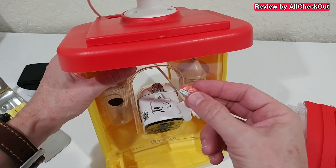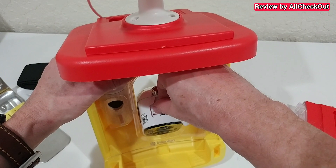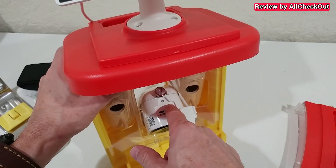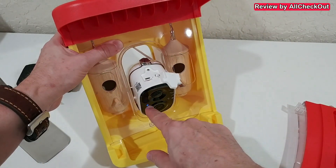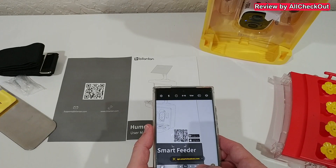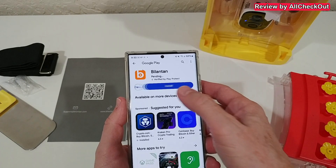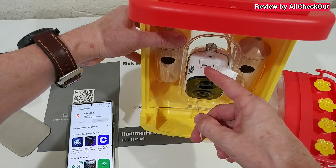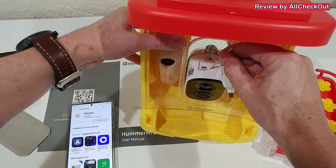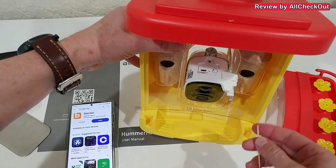We need a micro SD card — I recommend a fast Class 10 32GB card. Push it in with the pins going to the back. On the right side we have the on/off button — press it and you'll see the blue light. Then scan the QR code on the front with the camera. If the camera says 'network configuration has timed out,' use a toothpick in the reset hole, push it down for a couple of seconds, and it should reset.